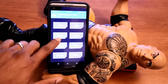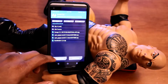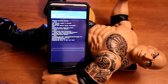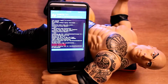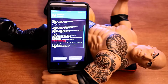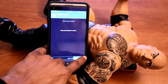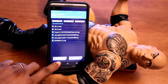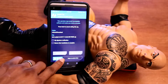Go to install and navigate to the path where you have the ROM downloaded. Mine is right here — LineageOS 14.1. Swipe to flash and wait for the installation to complete. You may see two red messages saying 'unknown command' — just ignore that, it will say that no matter what. Then wipe the Dalvik cache and go back because we still need to install the OpenGApps zip.